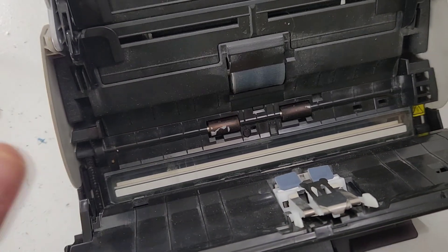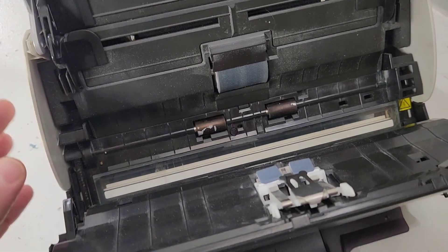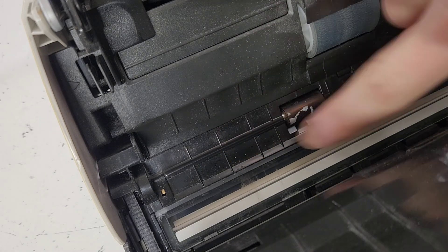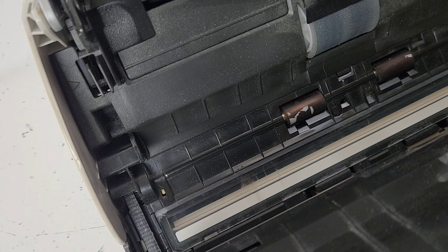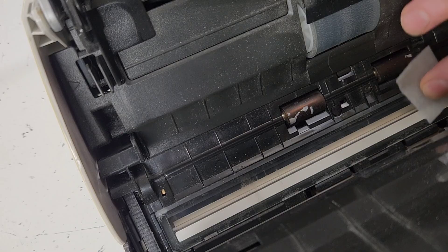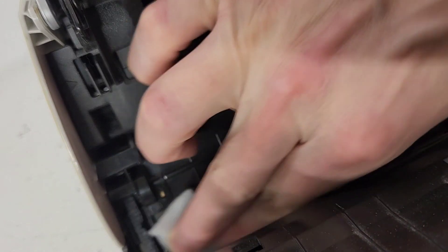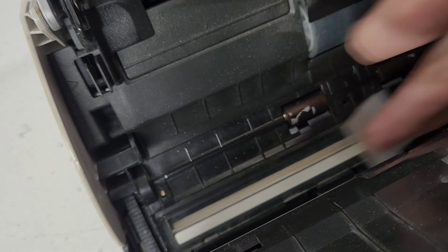Keep in mind, you never want to spray any liquid or put any liquid in here because everything is electronic and you will mess up your scanner. So make sure you unplug the scanner first. A few things you can use to clean that: either a rag with some hot water — once again, don't put anything here and make sure the rag is not very wet, just enough to clean this up. Or I usually just go with an alcohol swab cleaner. I'll do that on the rollers also and on the glass — that works very well. And obviously you can use a paper towel with either warm water or window cleaner. Why I like the alcohol is even though it's wet, it dries quickly so you won't damage any electronic pieces or any other parts.